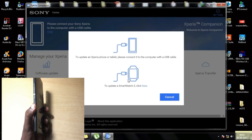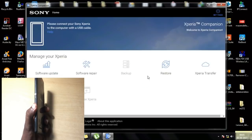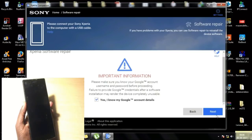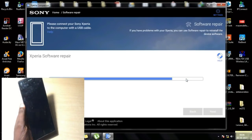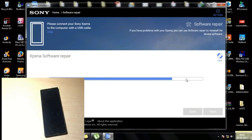After that, simply click on Software Repair, then connect the phone to the computer while holding the Volume Down key. You can read it clearly on screen. Connect with Volume Down held, then you'll get the terms and conditions — select Yes and Next. This will start the software repair process. If you're using Xperia Companion for the first time it will take around 10 to 15 minutes for initialization; if you've used it before it will take about two to three minutes.